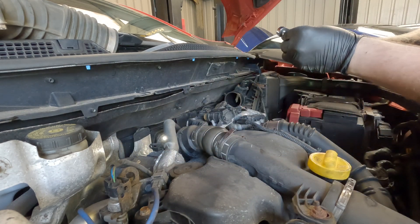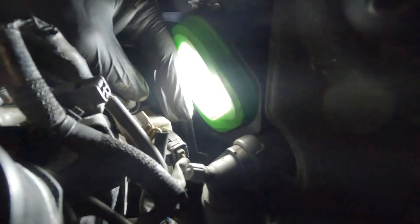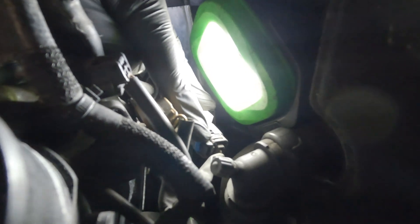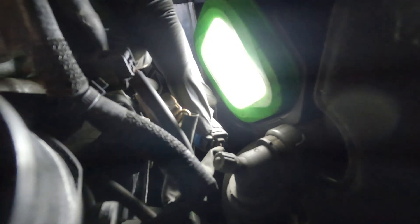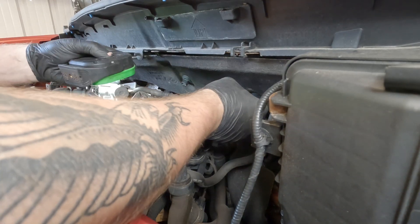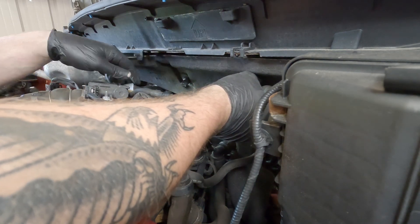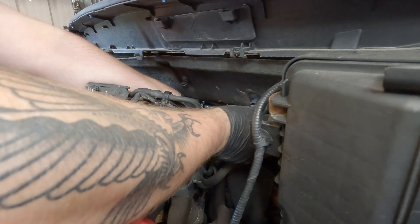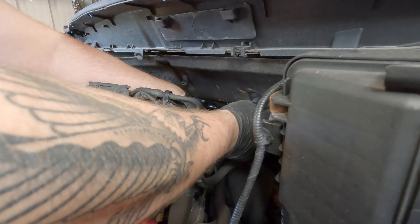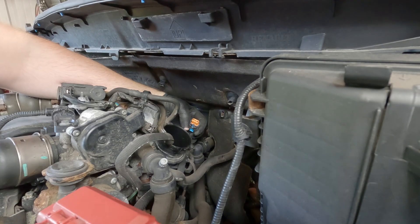There's that 7mm bolt — just put that somewhere safe. Once you've undone that bolt, the sensor will be able to lift away from the bracket. You can see the electrical connector there. You'll have to get a little pick to help prise back the security tab and then you should be able to disconnect it. I'm just going to use a hook to try and get down here and prise back this tab. Shadows from the light can be a real pain when you're trying to do this. I've got that tab disconnected.